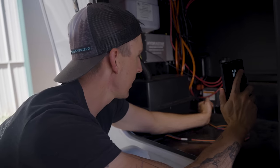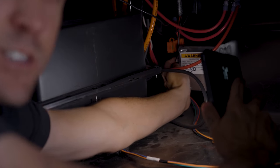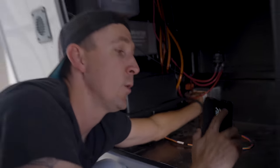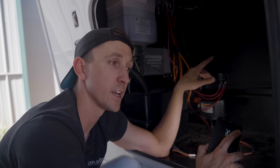The other thing to notice right back here - there's a label on this red wire that says 'solar in,' which tells me this thing is solar ready. That, plus the stickers on the inside of the camper, means we're going to have PV connectors or MC4 connectors up on the roof, so we don't have to fish any wires down from the roof to this compartment here where we'll eventually install our charge controller.